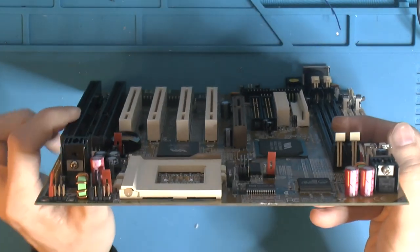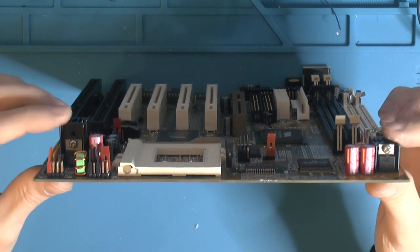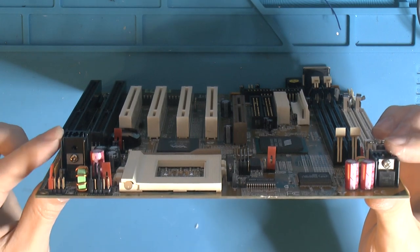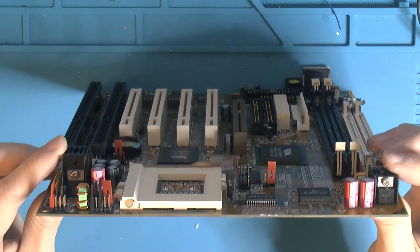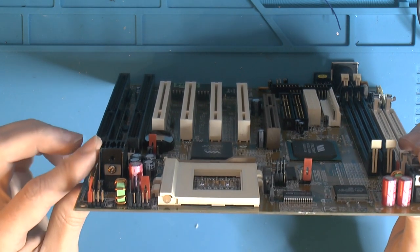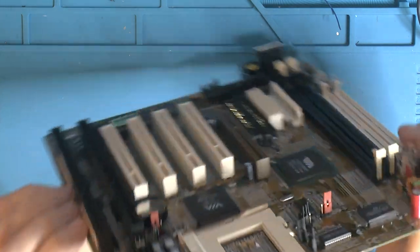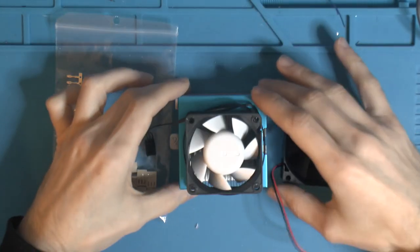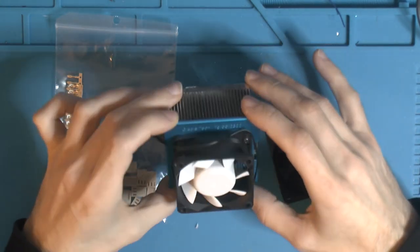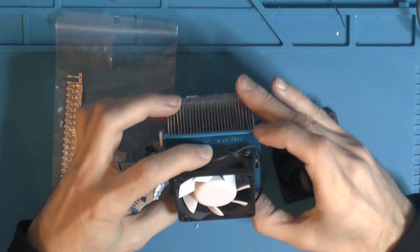You can see the original height versus the new height. I'm going to measure the temps later to figure out roughly how much we bought on temperature. I'm also going to have a front case fan blowing over all of this. I figured the old ones were too small to achieve the temperatures I want. For a CPU cooler I'm going to use an Athlon Thunderbird cooler — it's a Glacial Tech Igloo 2320.